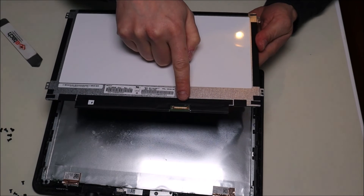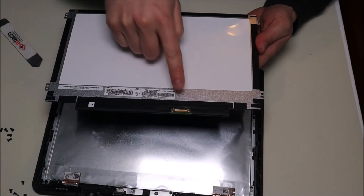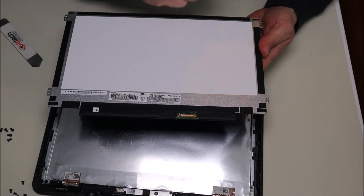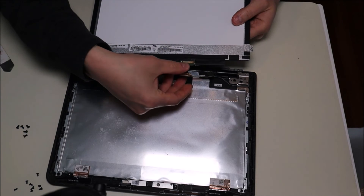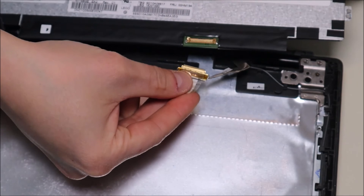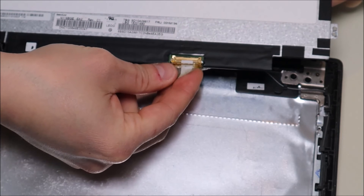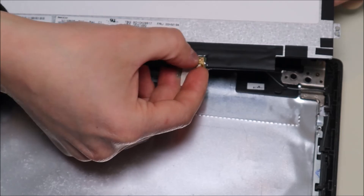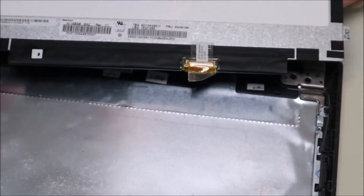You'll also need to know whether this is a 30 or 40 pin connector when replacing an LCD — you can count the pins, but this is a 30 pin port. To put the cable back in, hold the port down steady, take the LCD cable, put it flush next to it, and slide the two together. Then take the metal bar, slide it down over the port, and push it down to lock it in place. For added protection, make sure that sticker is back down where it should be.